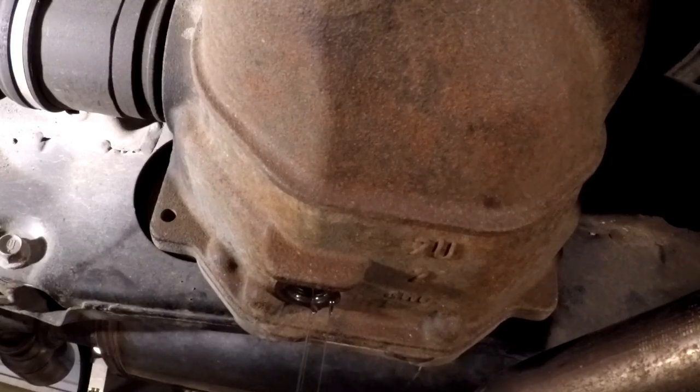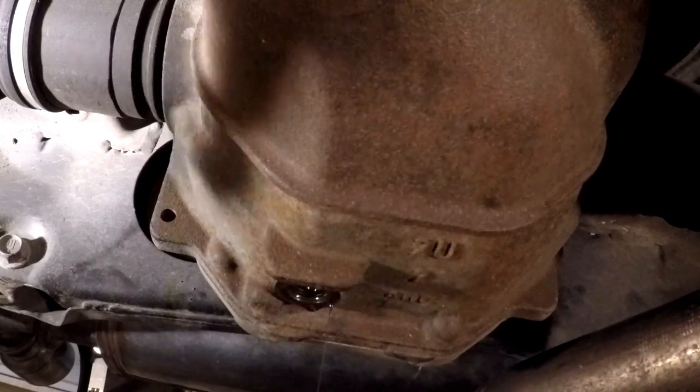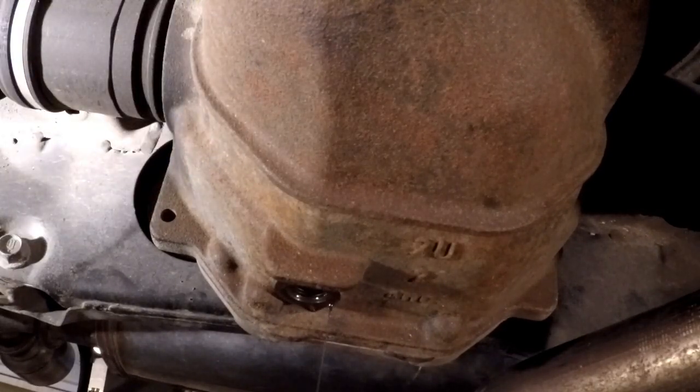And I'm going to get some rags and stuff to clean up the mess. And I've already got the torque wrench set for 36 pounds to go back. And as soon as this is done, we're actually going to be putting these underbody panels back on and getting this thing put on the ground. I still got to put my wheels back on. They're still in the back of my Mazda from the shop. And I had lunch, so needed my McDonald's greasy food.